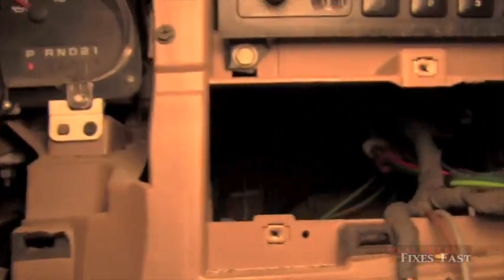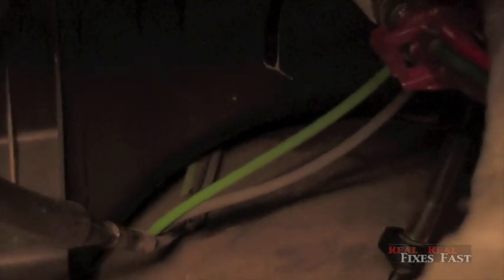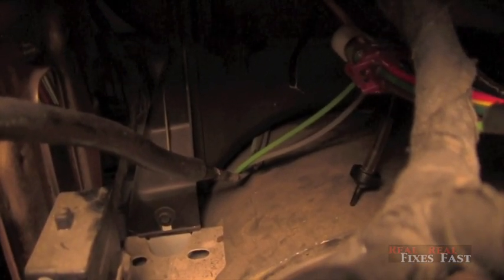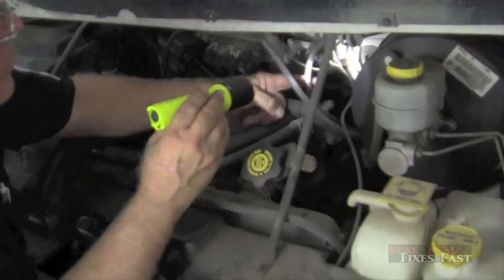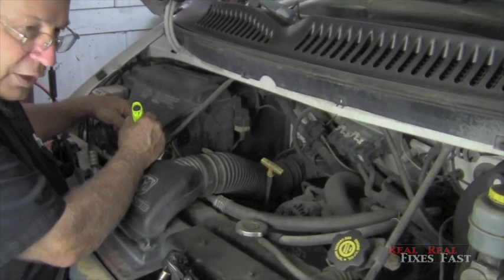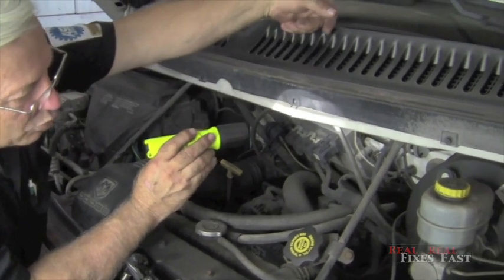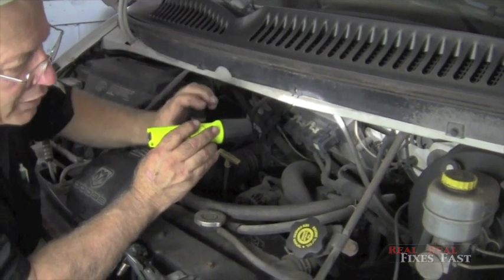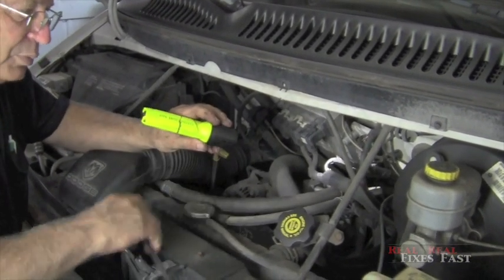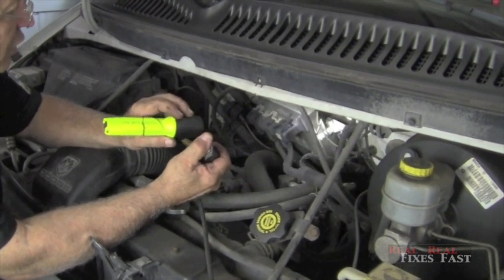I'm going to get my smoke tip and insert it into the same place down there. I have my smoke tip inserted, and if you can notice right here, these vacuum lines go immediately forward — they go under some of the duct work, and then they go out through the firewall into the engine compartment. When I turn on my smoke machine, I'm going to go out there and look for the smoke. We're out underneath the hood, and coming from the firewall, you can see right here is where the vacuum lines come through the firewall. They wrap around here, go to different valves, and go down to the vacuum reservoir. I've got my smoke line on the inside coming this way, because my vacuum source would be here — I want to know from there this way where I'm losing my vacuum. We're going to turn the smoke machine on and start watching for smoke.